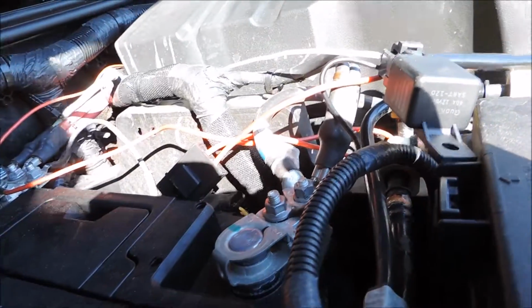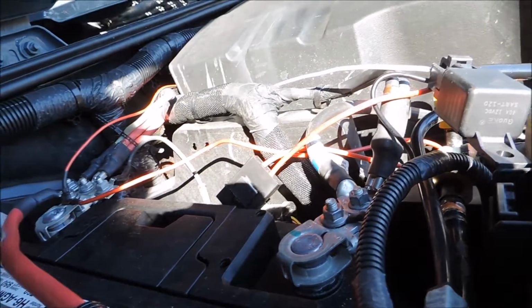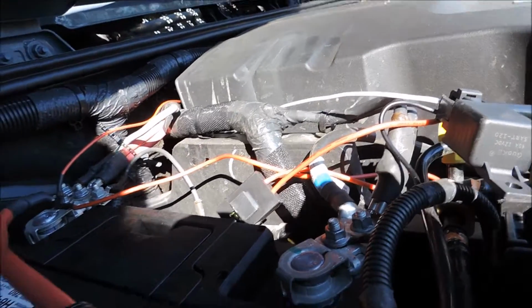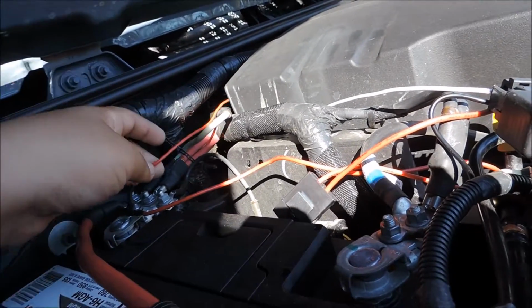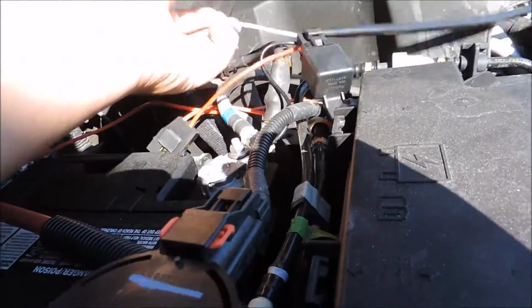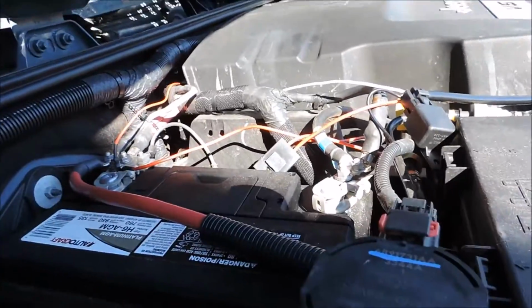It's fairly simple to connect. I'll link a diagram in the description for you to follow if you have this light bar or the wiring harness. You just connect the ground to the ground, the positive to the positive, and this white one, you run it all the way to the other side. Let me go ahead and show you where to run it into the cabin.